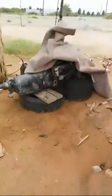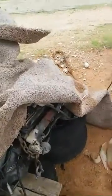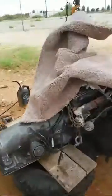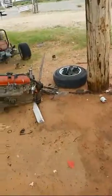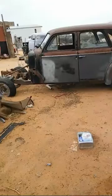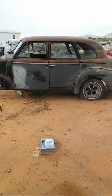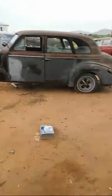But yeah, this is pretty much almost all really clean. Almost got to the metal, everything, so we're about to paint that. Since it's the later model small block Chevy, if you guys notice, the valve covers have the bolt through the middle. Whoever knows out there, the older ones have it on the sides, right? Since that one came black from factory, and this guy wants to do this car black on black on black, and for ease of everything, putting it back to original color is always easier than changing colors on anything. So basically, we're keeping a black block. That's what I'm trying to get to here.